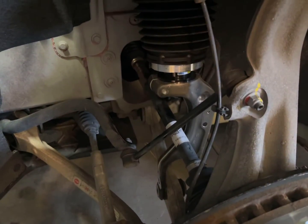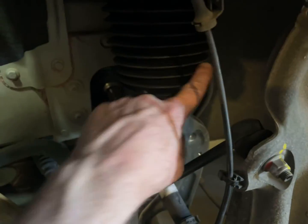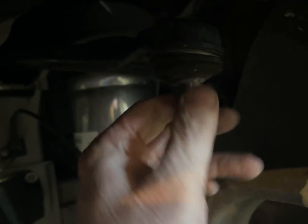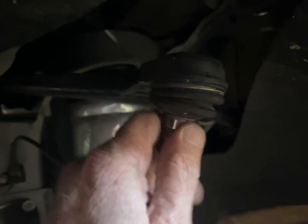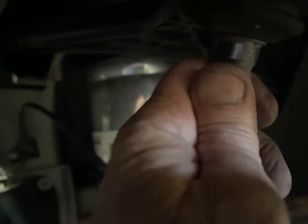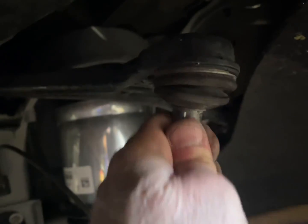Anyway, that's what I'm up to — hopefully that's helpful to somebody. Let me know. Make sure you take that speed sensor anchor off and take the brake line off the bottom as you're uninstalling it. All of this stuff you can look up. I'm going to lube this up while I've got it off — it seems to be, well, you can hear a little creaking. Yeah, you hear that? I might squirt a little lube up in there. I've got an injector needle, so I might put the injector needle in there and fill that full of lube, because that's creaky. Alright, best of luck to you — let me know if you have any questions.